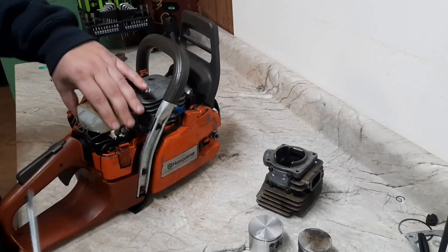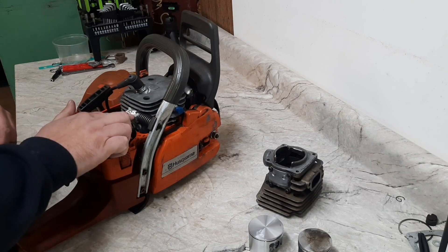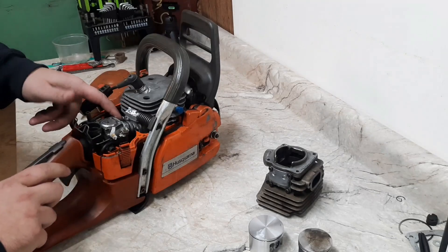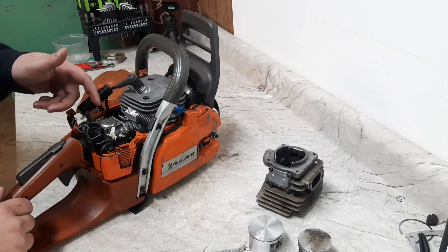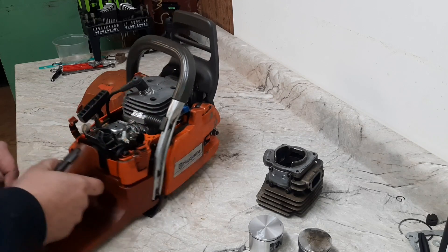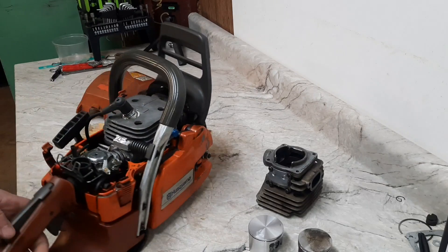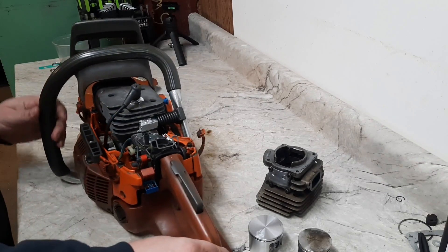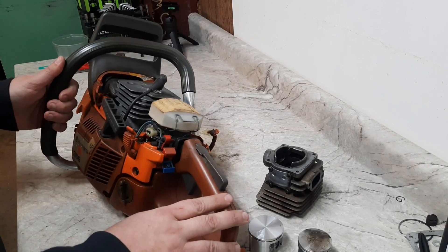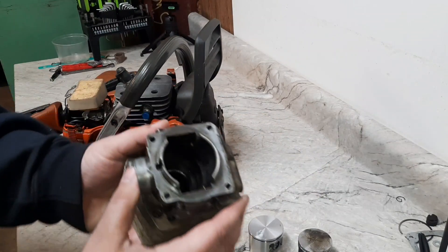You can see we're utilizing the factory carb, carb elbow, and air filter. Had to add a mount for the AV spring, made an intake boot that's just a pair of flanges with a hose, added external impulse to the side. Still got to get the muffler mount done, but overall pretty happy with the way it turned out. It's much bigger, but if you don't know what it is it's awful hard to tell — that's what she looks like.